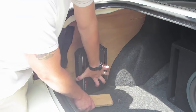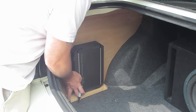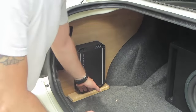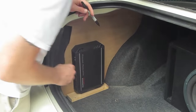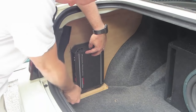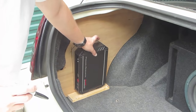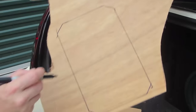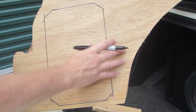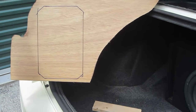For my piece that I'm going to use to space this out — this is a one-by — I'm just going to lay the amp on top of there on my bottom straight edge and just space it out so it's centered in there for the most part, a little bit of wood on either side, and that looks just about perfect. So I'm just going to trace the amp out now. I'm going to pull this off — you're going to see I don't have markings on the bottom because I can't get at it, so I can just take this all down, pull it out, there's my amp. So I'm going to cut this out. Once this is all done, I can start covering this piece with material, wrap it up in there, then start mounting the amp on the back so I'm getting it ready for my supports, and that coffin panel should be all set.